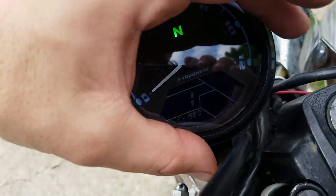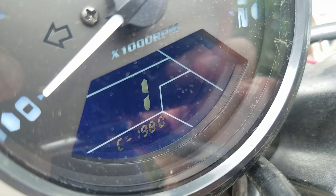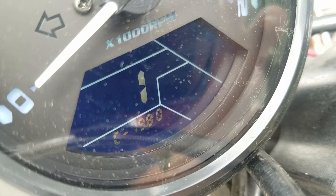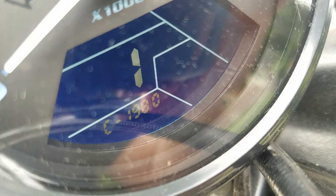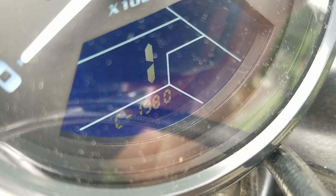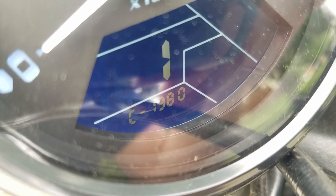I went ahead and got into the settings menu. Right now we're on setting one, which is where you set your tire size for the speedometer. Coincidentally, the tire circumference that got this to read a decent reading was the same number as the year of the bike. You measure the circumference to get close, then tweak it until it's about right. I used a GPS speed reading to calibrate it, and that's good enough.